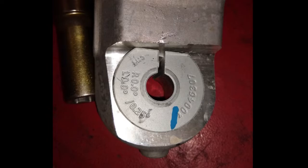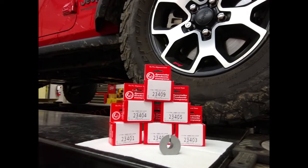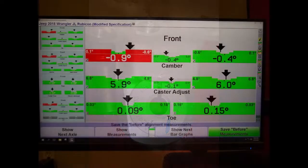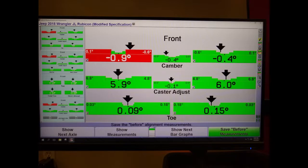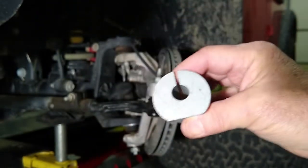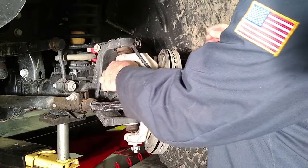Because the ball joint is mounted in the axle housing, the alignment sleeve is not capable of caster change. Select the proper size sleeve needed for camber correction. In this example, the stock sleeve was 0.25 degrees positive camber. Another 0.5 degrees of positive camber is needed, so the proper sleeve would be a 0.75 degree, or three quarter degree, part number 23403.